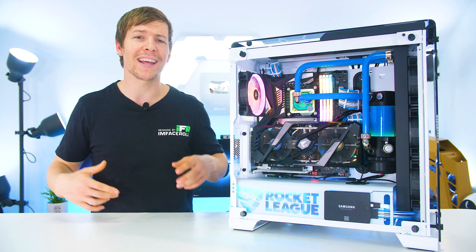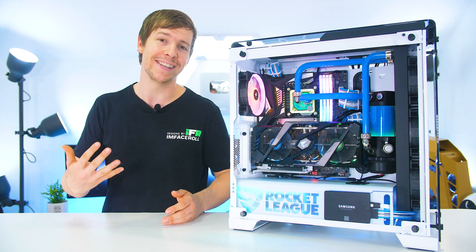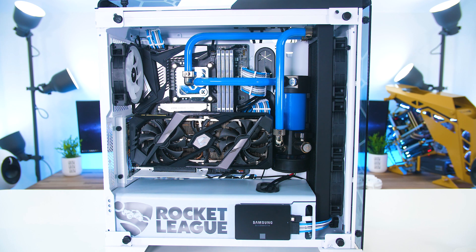Let's power this thing down and go ahead and drain this system. Our first step is to layer the bottom section and the CPU block with paper towel, where no spillage could occur while draining. In a lot of our videos we don't use paper towel because we want to show people what they're doing, but normally what you'd want to do is definitely lay paper towel down so you're not spilling liquid on any components.